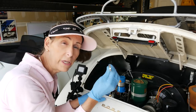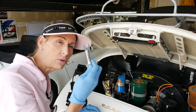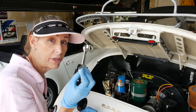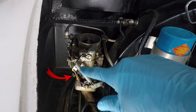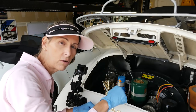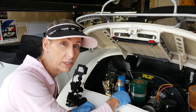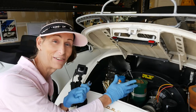It's really hard to get these things off with a normal size wrench, but this little baby 12 works great for this sort of thing. One thing you have to be super careful of: the thumb screws on the side for the air blades are made out of brass, and it's so easy to just kind of go right into one of them and bend them. So if you're ever taking off a Zenith carburetor, just be careful with that.